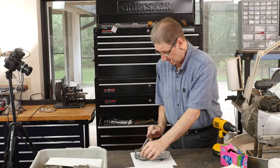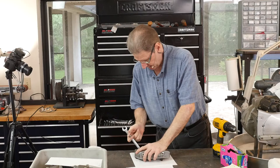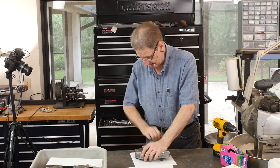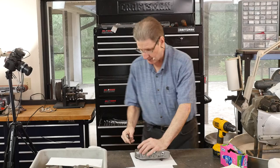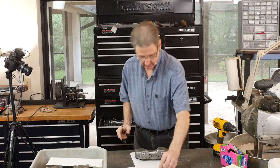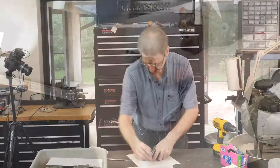If we're lucky, this will snap loose without spinning the shaft. It did. The reason these nuts have this red plastic cap is so there's no corrosion or dirt, and you can get this off without spinning the thing. There's the nut with the little red cap. You could use an acorn nut or a commercial showy kind. There's a thin washer — not a standard washer.